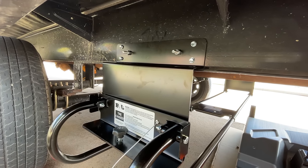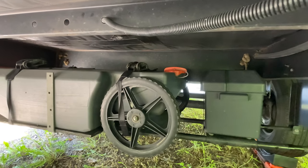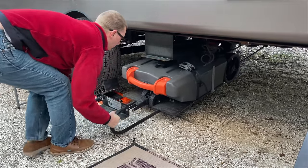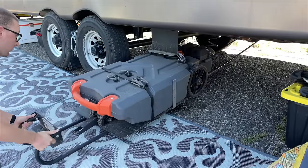After using this tote for over two years, what would I change? One, I'd make the bracket one inch longer — that extra inch would ensure anybody could do this modification using the same spare tire carrier principle. The other thing I'd do is figure out how to remove the entire bracket when taking the carrier down, or make it hinge, so when I take it down it's out of the way. That would give more clearance to pull the tote out without having to lift the RV as high. Finally, a few squirts of lubrication on the poles where they slide into each other definitely helps. There's metal-on-metal friction that can make it rough to pull out depending on the angle, so lubrication is something you need to remember to do before pulling out the slide.